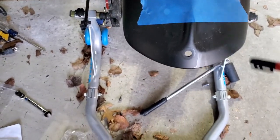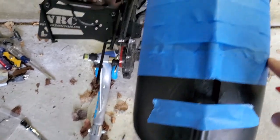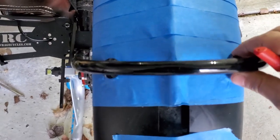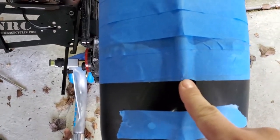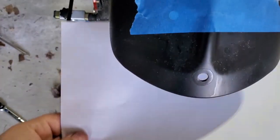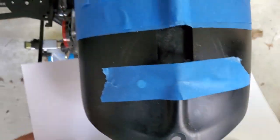What I'm going to do is recreate this profile here and transfer it so that it leaves the mounting brackets for the support. That way it's just going to support a very little bit of material. This is where the curve is going to end, and in order to recreate that, I'm going to take a piece of paper, trace that profile, cut it, and transfer the line here.